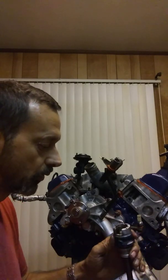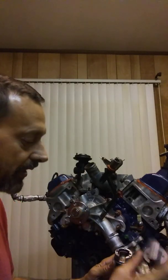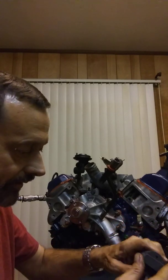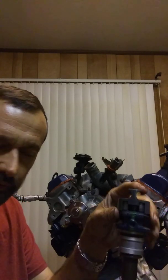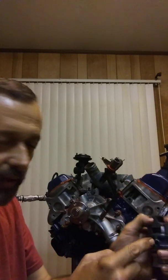The engineers that made this weren't trying to help you. You've got to have the special tool to get this thing synced up to where it needs to be in relation to the sensor when all of this is at top dead center. Basically, what you have to do is take this — you see it's got a little half circle in it too — and you've got to engage the little half circle that's in this thing with that. Once you get those notched together, then you've got to turn this thing until it goes into that little groove there, the slot. All of this whole thing is locked together. As long as I keep that little tool on there, this thing is locked together.